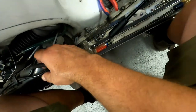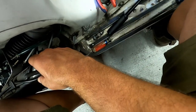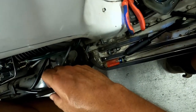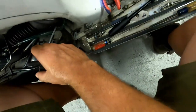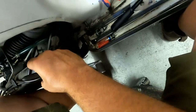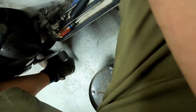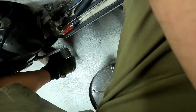So I came up with an idea. I took a piece of fuel line, cut a section of it, and used a couple of hose clamps. I trimmed down the choke cable, slid the fuel line over the choke cable, put the choke cable in place, and used hose clamps to hold the fuel line to the choke cable itself, then used another hose clamp to hold the fuel line to the choke tube. This kept the choke outer cable fixed in place on the tube. I had to trim the cable back a little because without being able to remove that little ferrule, the outer portion of the choke tube was too long to choke properly. It ended up working great — the choke cable was nice and smooth, and I was able to get the bike all back together again.